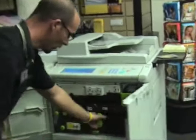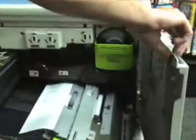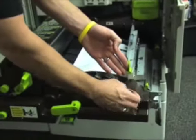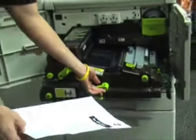What we're going to do is open the front of the machine. We're going to pull this main tray out by turning handle A down. Pull that out and all of a sudden you see there's our jam right there. Lift this piece up here, use that roller to pull the actual jam out, and you're good to go.